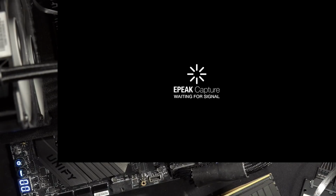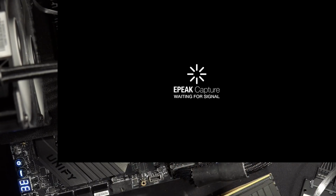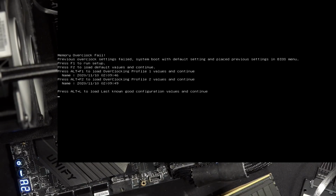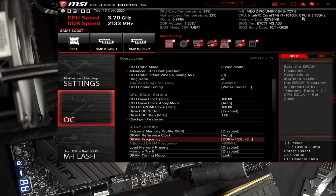Why is it 55ing? There's a bit of a chance that there's a contact issue with the memory sticks. Or technically this board is a daisy chain, but on a previous BIOS version, 4400 would work. Okay, well, it looks like the frequency's gone down. So I guess I might have to run 4266, or we can try training it, I guess.